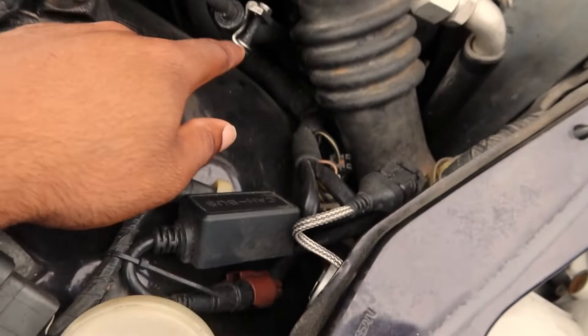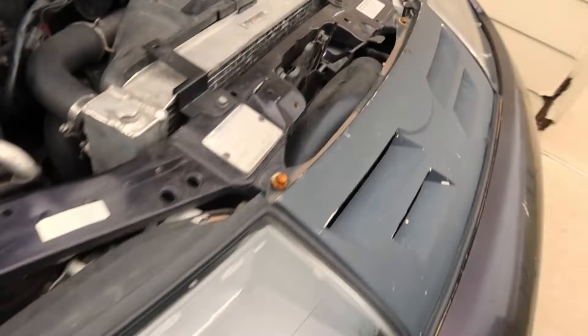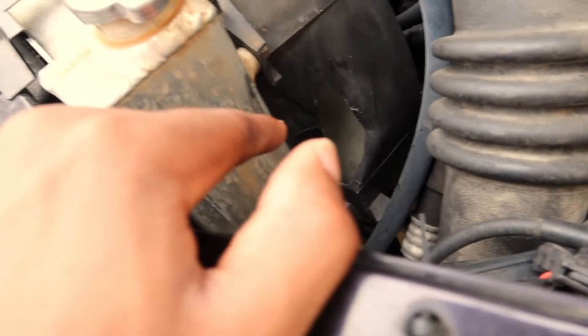Last thing I need to do is go get the oil, the coolant, and distilled water. Coming under here, I really need to replace this hose - it's pretty soaked in gunk and I'm pretty sure it's leaking some fluid. I already changed the O2 sensor, but I might do the other one as well, I'd just feel better about that. I need to change this out or somehow repair it because it's real jank. Just a giant hole staring back at me. Got to get that fixed - I just got to restore her.